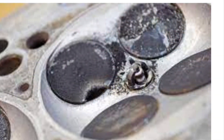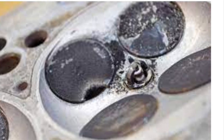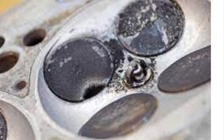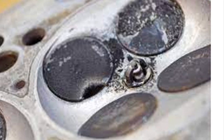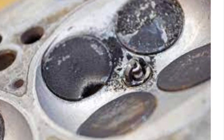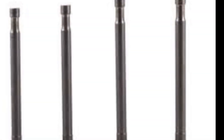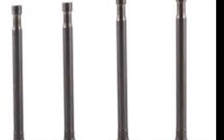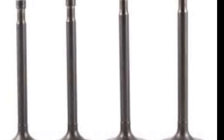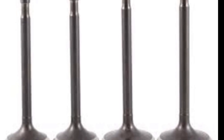I'm not saying it's impossible to burn up valves from a lean mixture — I'm just saying it's way, way harder than people think based on what they read on the internet. If the bike runs well and feels good, this is not a problem. Your bike would run so poorly that you would know there was an issue and you'd stop riding it. It's not like it's going to be some silent killer where the bike is running great and then 10,000 miles down the road you find out it was a little lean and you burned up your valves. So can we please stop with the 'you're going to burn your valves' police on the internet? It's obviously tempting for a tuner to propagate this feeling that you've got to get a tune or you'll burn your valves, but in most cases it's just not true.